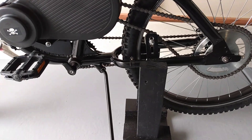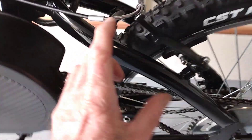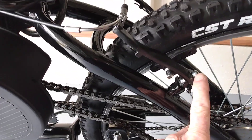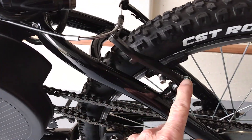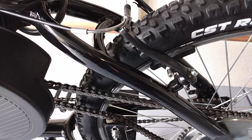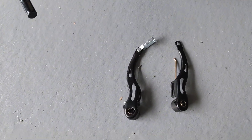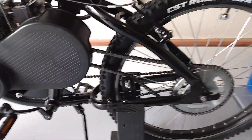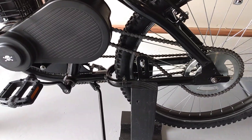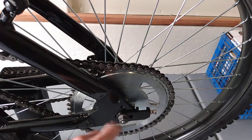That's about it on the fat moto. I recommend upgrading those V-brakes — I think this is 106 millimeter, they measure from center to center. I've seen them on Amazon, pretty decent set for $10, $12, $15 with the pads or shoes or whatever they are. This stock stuff is just garbage. Now if you've got a 2020 model, you've got a disc brake on the rear which is an improvement. I'm thinking about maybe putting a 230 millimeter disc and trying to fit some adapter for a caliper — I'll work on that later though.